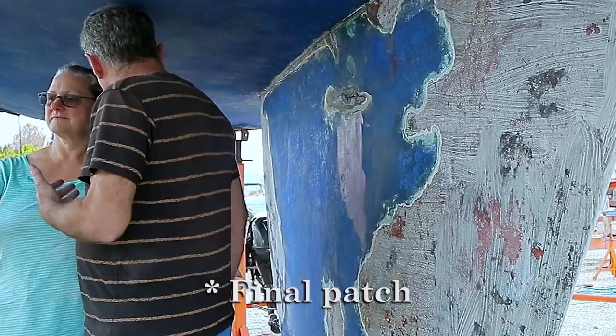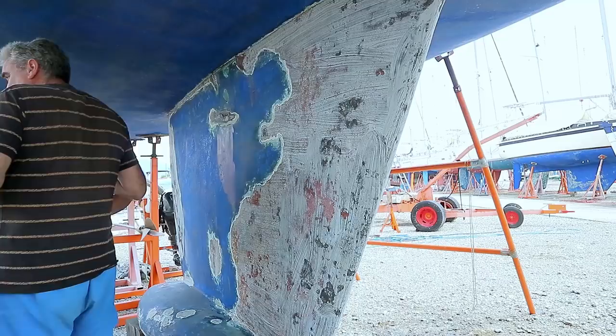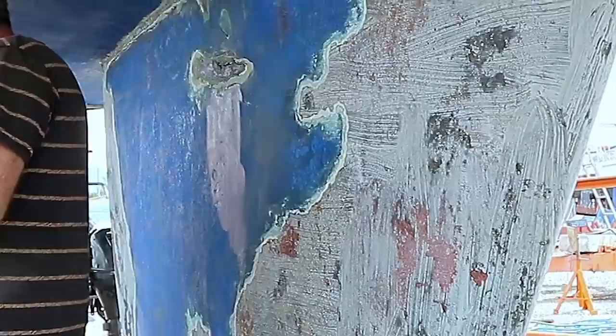It's been a little over 30 minutes now since the final coating of the rust inhibitor went on. As you can see, where the rust inhibitor converter is actually working it's turned into a white sort of discoloration. So now we've got to wipe that down with a damp cloth to remove whatever is being removed — the instructions don't say exactly — then leave that to dry for six hours, and tomorrow we put a second coat on all round. That is stage one complete.